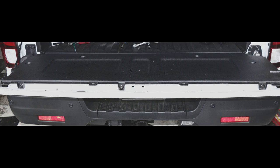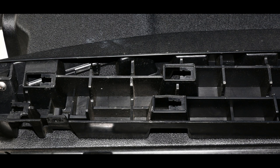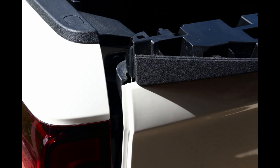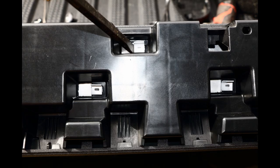The large interfacing of the tailgate using the Torx bolts goes in first, then the top edge mounted piece that slides onto the slotted retainers — this piece will take a little finesse. Install any clips that may have come off into the top of the tailgate and line all of them up correctly. Mine had a tab that has to be parallel to the tailgate. Place the large top edge plastic molding, lining it up with the large holes left of the slots for the retainers. Then slowly, in increments, bump the large plastic top piece to the left. I found I needed to use a screwdriver to line up the retainers between bumps. When the large plastic piece is centered on the tailgate, use your screwdriver to lightly nudge the retainers to the right to make sure they snap into their locked position.